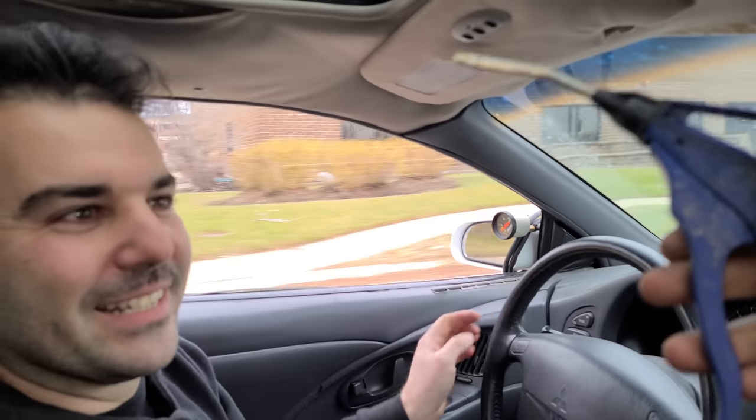All right, 10 PSI of boost is the most we got. Peter? It went down to 10 on the AFRs. Straight up 10 AFR? Yeah, that's as low as it goes, but it was kind of tickling down there. Wow, that is really rich. Wait a minute, that just means we have room to grow. We can afford some boost.